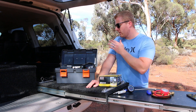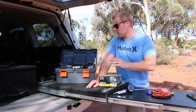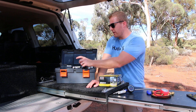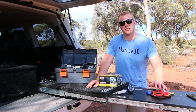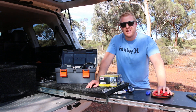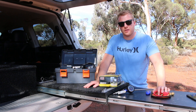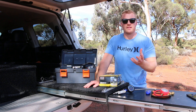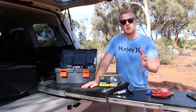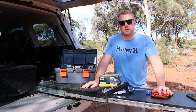I've been using the CK MA12 compressor for eight years and I've never had a problem with the actual unit itself. The only complaint is that the section of hose closest to the compressor does get quite warm due to operating temperatures, causing a few inches of hose to fatigue over time and eventually crack and split. I've had that happen a couple of times — what you have to do is chop the hose, re-plumb it, and you're good to keep going.